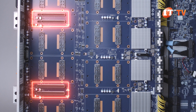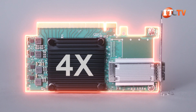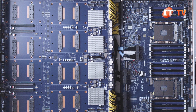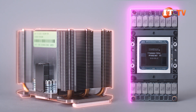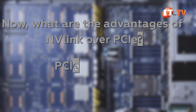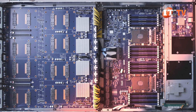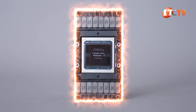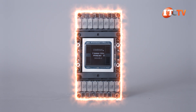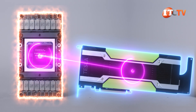There are two pairs of x16 PCIe 3.0 slots to support up to four Mellanox 100 gigabit Ethernet connections. Those network cards are in turn connected with one of the CPUs and two of the SXM2 form factor GPUs through the NVLink board. This design facilitates unhindered peer-to-peer communications and RDMA, or remote direct memory access. Compared to a PCIe-based GPU installation at up to 32 gigabytes per second, this one delivers 300 gigabytes per second — almost a tenfold increase in data flow. Those SXM2 Tesla V100 GPUs also have six bi-directional NVLinks featuring 25 gigabytes per second per link in each direction, making GPU-to-GPU communications significantly faster than PCIe-based GPUs, which use the PCIe bus to communicate through the CPUs, adding more latency.